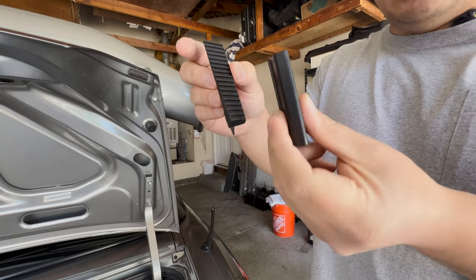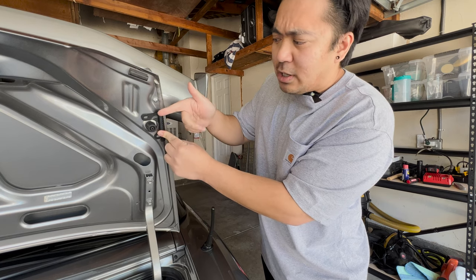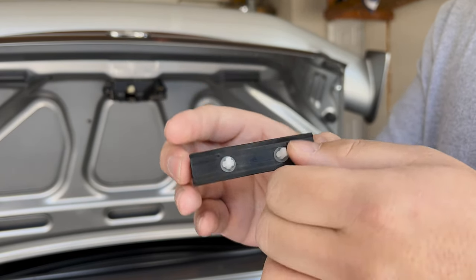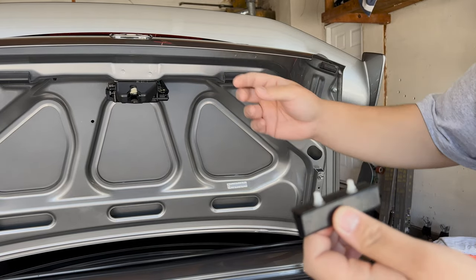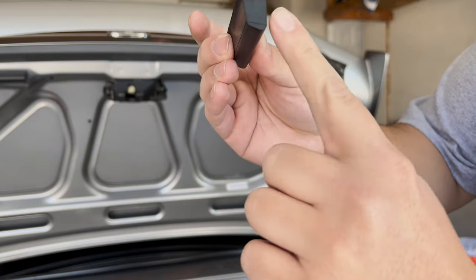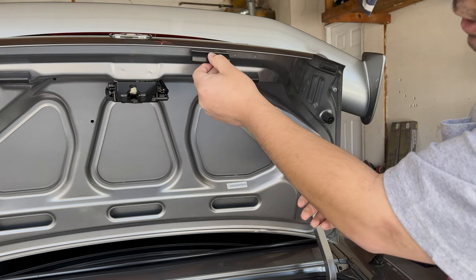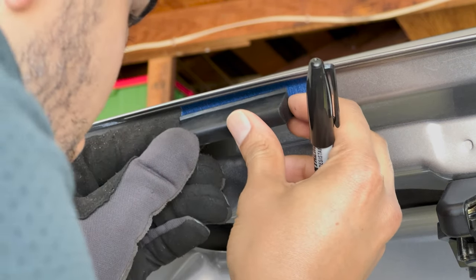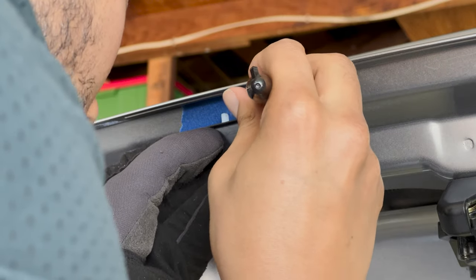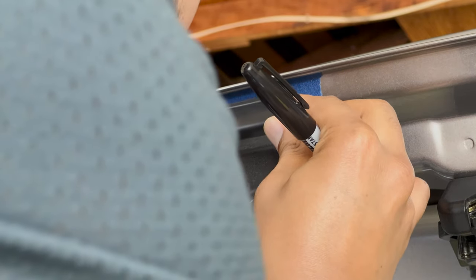We are going to be doing two types of bracings. This one right here is going to go right over here, around the trunk stopper, and it's going to sit flush with the side. And here is the other reinforcement brace — this is going to go along the end of the trunk, and when we put it in, we want to make sure the longer side is facing the actual trunk. Before we get started, all these pieces came standard in the Honda S2000 CR, which means you can still buy them directly from Honda. All the part numbers are in the description below.